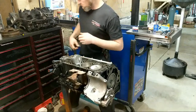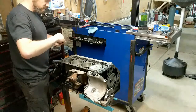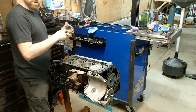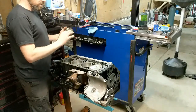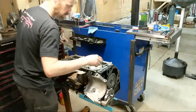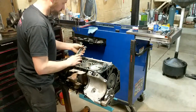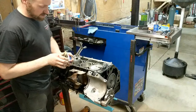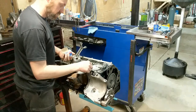So let's go ahead and start working on getting this piston in and get some measurements on the rod bearing. There are a couple ways you can go about it. You can measure the bearing inside after you put the bearing in, tighten the cap down, measure the bearing, measure the crank. That has been done - I should have about one and a half to two thousandths clearance. We are going to do it in the engine itself on camera.